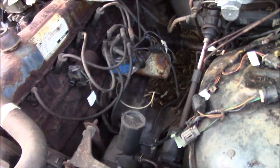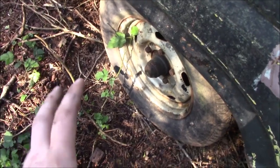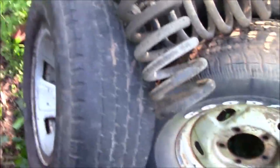The only thing we have to do now is start unbolting everything, getting cables out of the way. But that'll probably be in the next video. Something real quick. So the suspension on this truck is rated for like 1400 pounds per spring, and this spring's messed up. So what I've done is I went to the junkyard and I got some half ton coil springs out of an 89 F-250 with a 460 in it, and we're going to be slapping those bad boys underneath this thing so that we'll have some stiffened up suspension to support the weight of that motor.